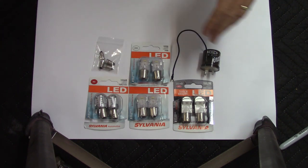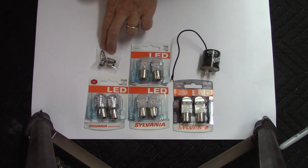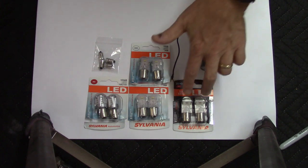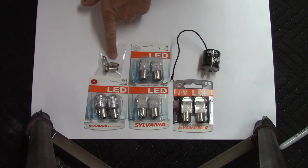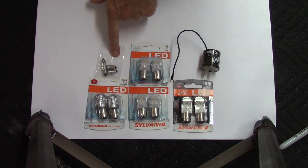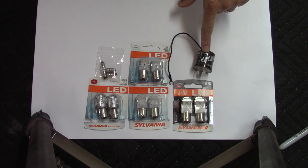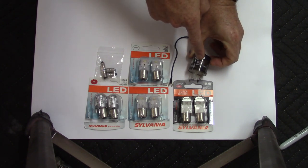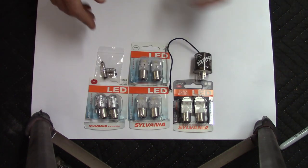I've got four sets of lights here — they're all Sylvania except for the little guys. For my brake lights, I'm using Sylvania 1157 Red. These are dual element lights: one for the tail light and one for the brake light. I also have Sylvania 1156 White for the front parking and front turn signals, and Sylvania 1156 Red for the rear turn signals. The small bulbs are for the turn signal monitor — a Chinese four-pack, not very expensive. And I've got a turn signal flasher, model number EF-33RL, which supports LED bulbs for the Triumph Spitfire specifically. I'll put links in the description to all this stuff.